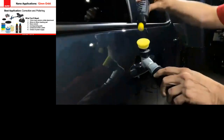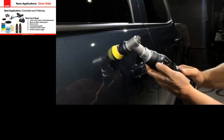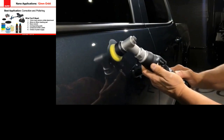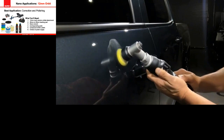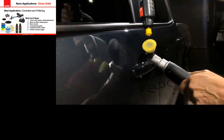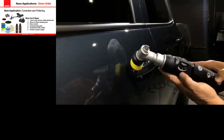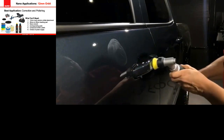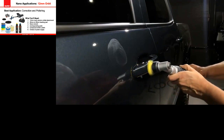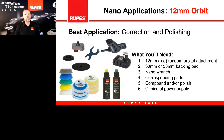First we show polishing with the 12mm orbit using the smaller one-inch diameter pad. In this case we're using ceramic polish with yellow foam, and we're taking a moment to prime the pad — like all our systems, you need to pre-prime the pad for best performance. Once primed, apply one pea-size dot of polish — this is what we call the reload. We go into the area to polish, and this is a beautiful reason for using the nano: painted door handles on cars, which are typically very challenging with a full-size tool or pad.